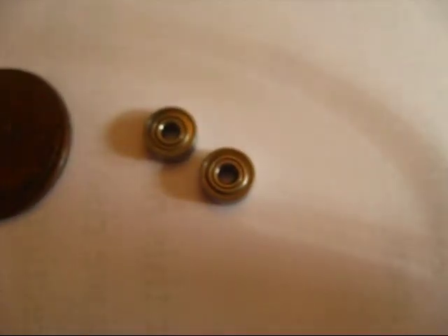You might be asking yourself, what are you doing with bearings that are so small? I couldn't figure out why my computer was running so poorly — it had programs that would get all herky-jerky, or every once in a while it would crash. I finally figured out that the graphics card was overheating the processor, because the bushings in the little fan were getting all munged up and the fan was rattling around making noise.